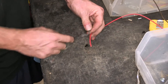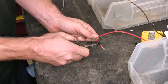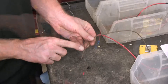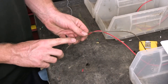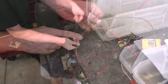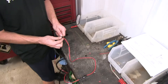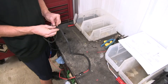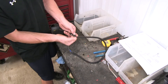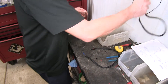On the other half of the wire harness, our red wire is going to be extended with the gray wire. This gray wire will eventually go to the cold side of the brake switch. Our brown wire will eventually be run to the black wire on our G-Force controller. Since this half of the wire harness will be removable, we'll use the included loom material to contain the wires. We've got our harness made - let's disconnect it from the monitor light. We'll install it a little bit later, so we'll set that to the side.